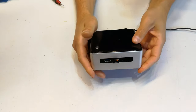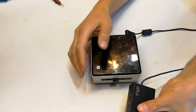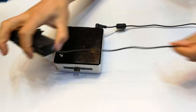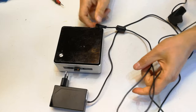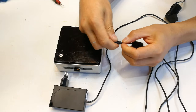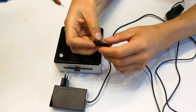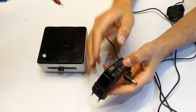So there's obviously something wrong. This is how I've fault-traced this. The first thing is to see if the power cord is damaged. I've looked at the power cord and the integrity is fine. An important place to look is near the strain relief to see if maybe somebody has pulled it too hard, and overall I'm happy with the integrity — although you still have to take a measurement.